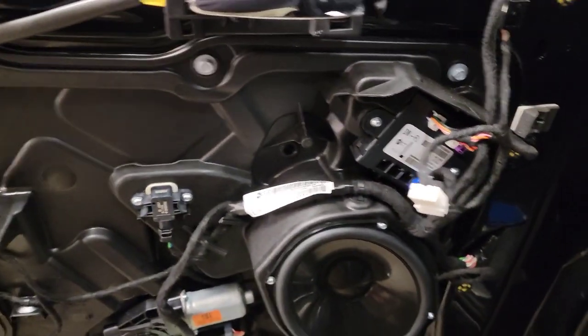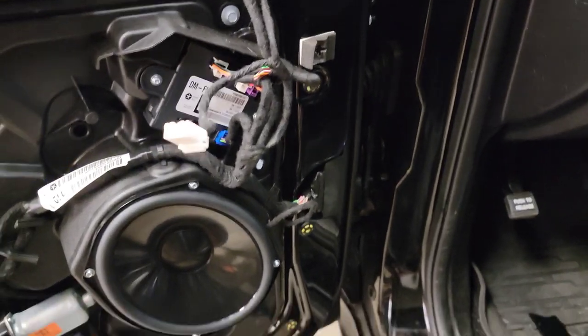So I did some testing. I plugged the tweeters in, and the tweeter is only getting the really high frequencies. I had used my meter. Everything was kilohertz. Although the factory tweeter has a little cap on it for a bass blocker, I'm assuming, this tweeter doesn't. I cranked that thing all the way up, didn't hear any popping or anything. In fact, my left ear is still ringing from holding it too close, but tested everything. Speaker actually sounds really good.